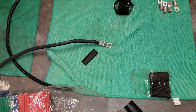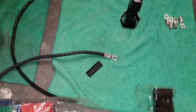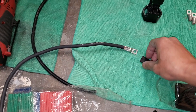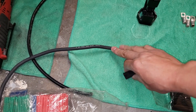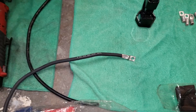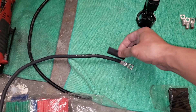Something else I want to do is add heat shrink to cover the connection so it has a nicer look. Before crimping your wires, make sure you put your shrink wrap on first. I'm fortunate that this one will actually go over it afterward, so that's what we're going to do.